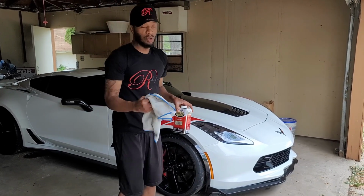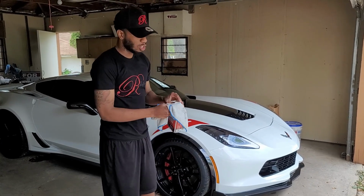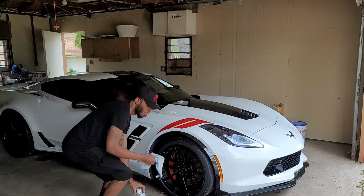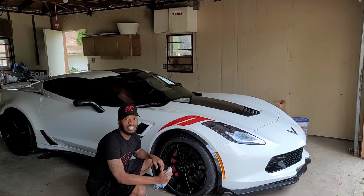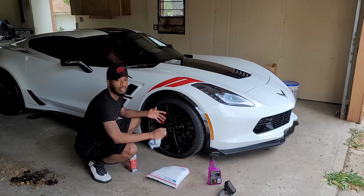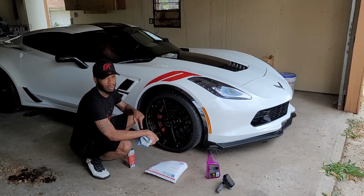You're going to put the acetone on the rag. I want you guys to listen to this very carefully. You're going to put the acetone on the rag. You're going to do it like this. Turn it, boom, put it one time. You're going to ball the rag up. Let the acetone do the work. Don't try to press hard and get all this, because what this is going to do is take all the dirt, grime, oil, and everything off so the tire letter can stick properly.